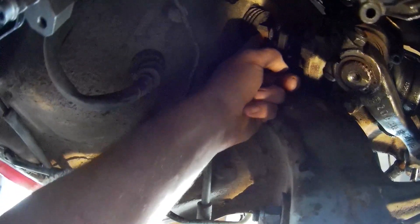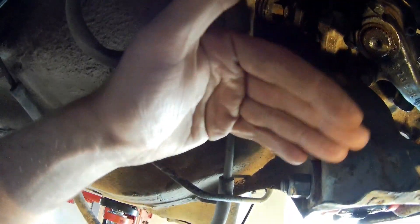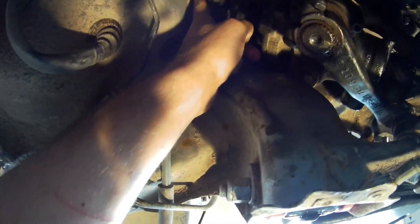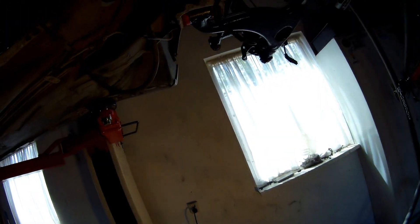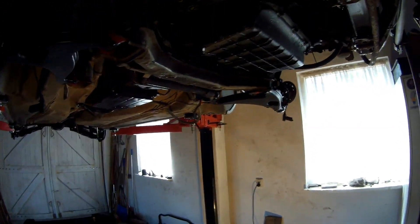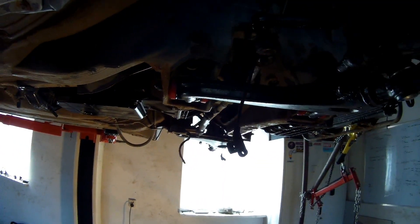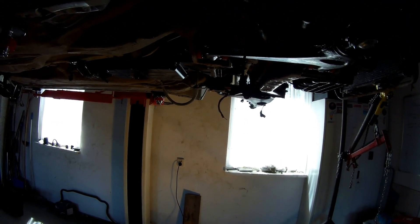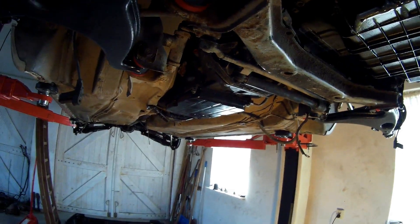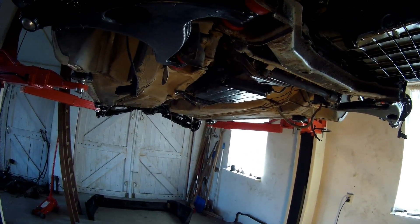It works very well because I already tested it. The only thing is that the axle is also going down as the steering box goes down. But in the engine bay there is a flexible joint that can easily accommodate that. The only thing I'm going to do on the car where the engine is going in is lower the hole to get it all centered - that's the only thing. So it's a very easy solution and I can still use the original steering box. I could have mounted a steering rack but I didn't want to do that because it's just a lot of work. Everything fits.